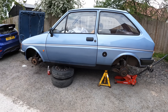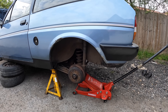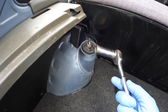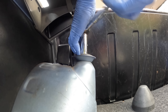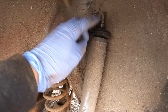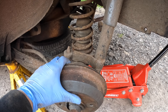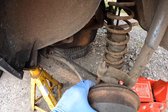Stuart's Mark II Fiesta is now jacked up at the rear as well. All I've done is removed the wheels. Now I'm going to get inside and undo the top mounts. I've come inside the boot — I need to remove this top little cover, and then it is just a 17mm nut to release the shocks. I've done the same on both sides. With the top nut removed from the strut inside the boot, the spring is nice and loose. I've got the jack under there just in case, but the only real resistance now is the brake lines and the handbrake cables.